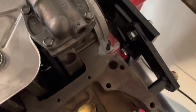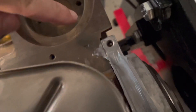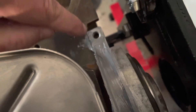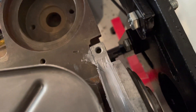I now have silicone sealant in the corners of this Mercury 5.7. I want to point out something before I lay the pan gasket back on. Over here in the corner, sometimes the paper gasket will stick up past the surface of the block, and you want a smooth transition from this aluminum piece to the steel. So what I do is take a razor blade and slice that gasket so that it's flush with this surface — you don't want that piece of paper sticking up and hitting the rubber gasket and possibly causing a leak point. I've already taken a razor blade and cut that one flush; over here I didn't have that problem, so I didn't have to cut this one.